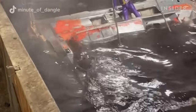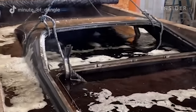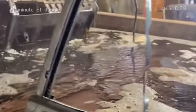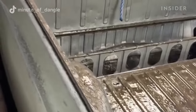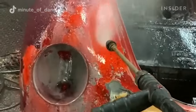The only problem we come in contact with is that our alkaline paint stripper actually eats soft metals. So if there's aluminum, magnesium, or pot metal on the car, it'll react and dissolve it. We'll dip the car and look for any reaction — if there's a reaction, we'll pull it out. We'll go over the car with magnets to find specific parts. You can usually see the part that's reacting, and it's a slow reaction, so it's not like you put it in and it's ruined. It would take a few days. When we find that, we remove it and solve the problem that way.